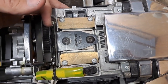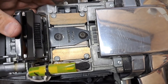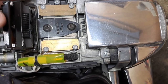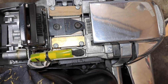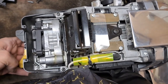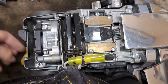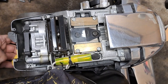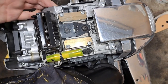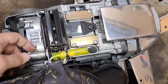Look how tight that reverse is now — we've got maybe an eighth of an inch that way and an eighth of an inch forward. You always need to have some play; if it's too tight your back wheels will just constantly spin and you'll wear out the clutches. Whenever you're not putting any pressure on the handle, you should always be able to turn the Kirby on, lift up the back of it, and the wheel shouldn't be turning even with the machine running — unless you put pressure on the handle. We're going to test that right now: fire it up, lift the back, and make sure the wheels stop spinning when we release.